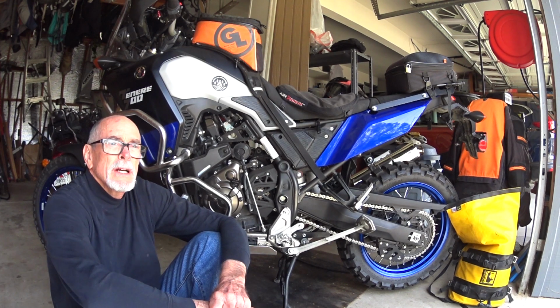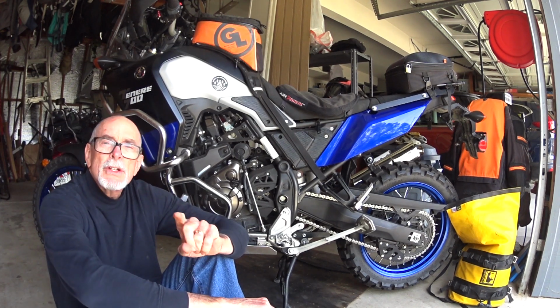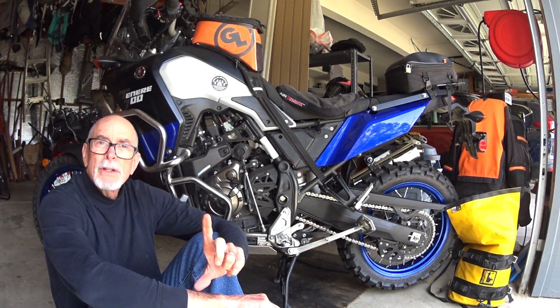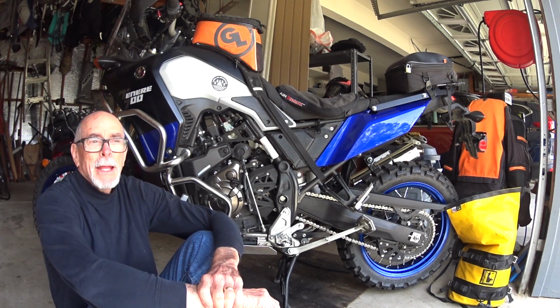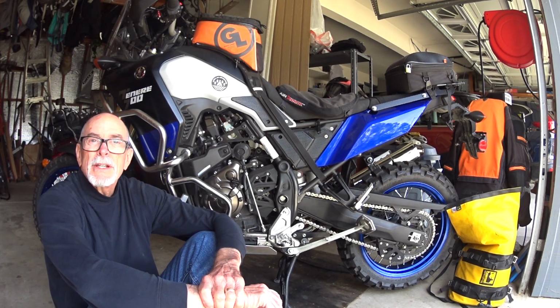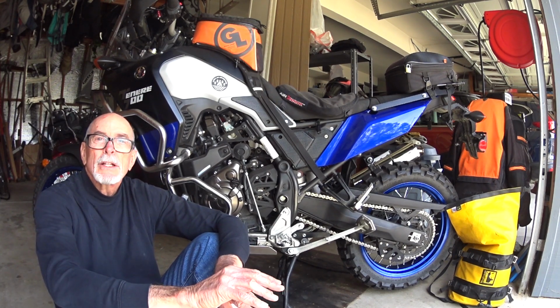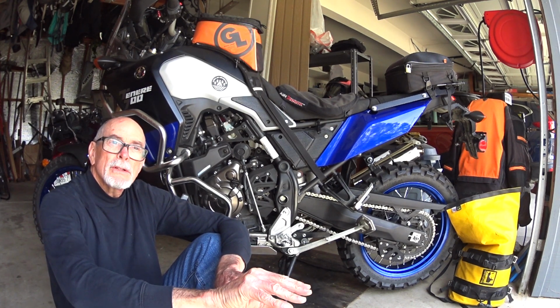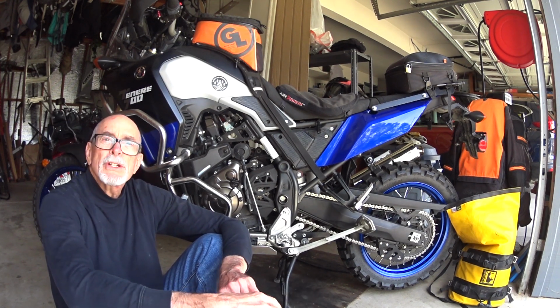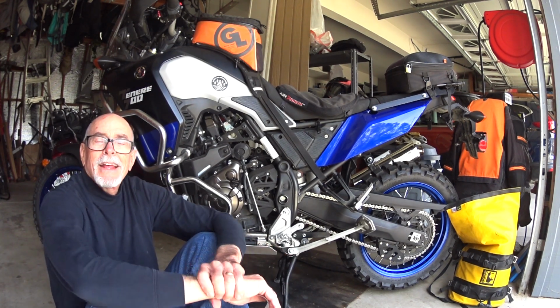One more thing I added, I wish it had cruise control. That would have been really nice, but then the price would have gone up on it. But I did put one of those plastic cruise controls on it that fits over your throttle, and then when you get it to a certain speed, you just press it down and it holds it against the brake lever. And it works great. You get up to about 70 and you want to lock it in, you push it down, and it'll hold it, but not perfectly. In other words, it'll fluctuate a little bit. But what's nice is it holds it at roughly that speed, and when you go a little bit too tall or a little bit too low, you're taking a lot of pressure off of your hand. It's just a light touch that you're moving it up and down real lightly, and that throttle control thing works great.